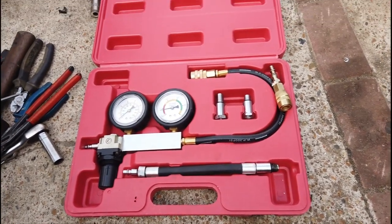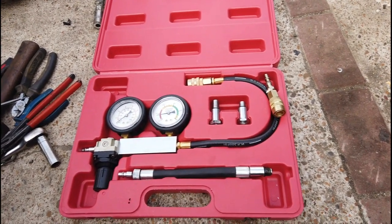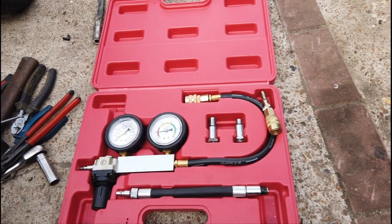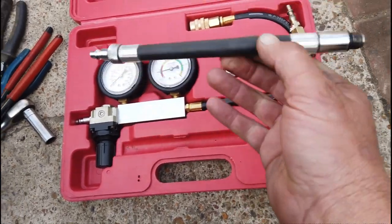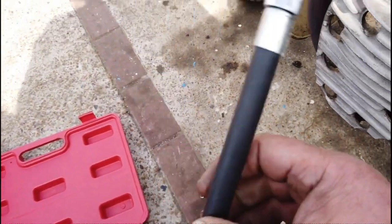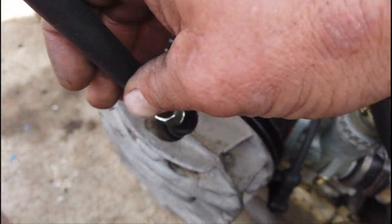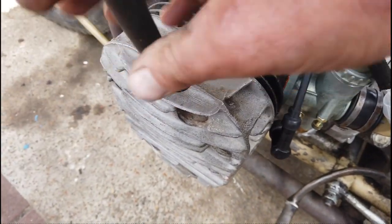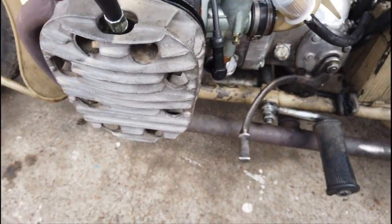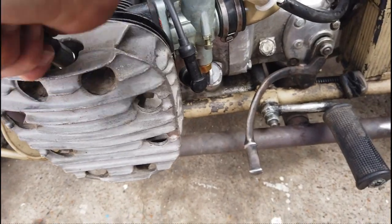This is the gauge itself. On the left you've got pressure coming in, which would be about 120 psi. On the right you've got a 0 to 100 percent pressure gauge, giving you an idea of what leakage you're going to get. You just get the basic adapter that fits into your spark plug hole — very basic, just screw it in. No mole grips, wrenches, or spanners — just hand tight. There's a small O-ring on the bottom, and as long as it's hand tight you won't get any leak from the top of the cylinder.